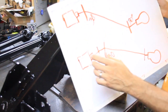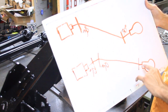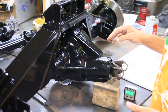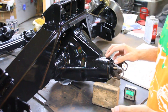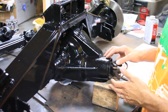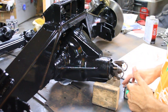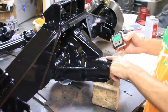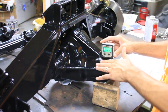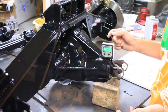Remember, it depends on which type of drive shaft you're running as to which pinion angle you want — whether you want it to be straight forward, or whether you want it to be pointed up at the transfer case. Another thing people often ask is where to take your pinion angle from. The pinion angle number really doesn't matter all that much. You either want it to be opposite of your transfer case angle, which is usually straight forward, or you want it to be pointed up at the transfer case. If you really need to know the angle, put the gauge somewhere parallel to the pinion. If you put an angle finder on there, you can see I'm sitting at 4.5 degrees of pinion angle.